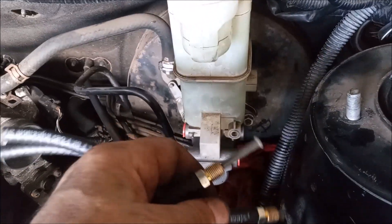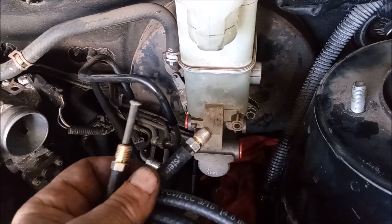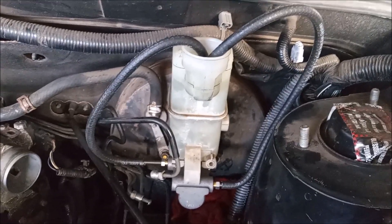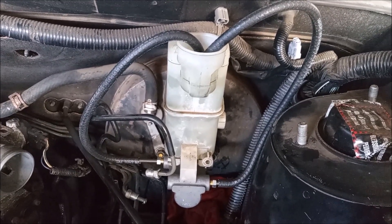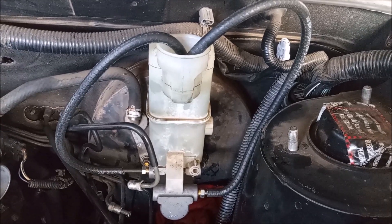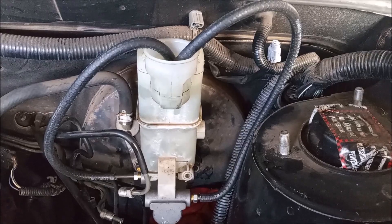I have these pieces of brake line that I connect to hoses. I'm gonna thread these into the ports of the master cylinder, run the hoses back into the reservoir, and then use the brake pedal to bleed the cylinder. I've threaded the fittings into the master cylinder, run the hoses into the reservoir, and filled the reservoir with brake fluid. Now I'm ready to start bleeding by gently pushing the pedal back and forth. The important thing is do not push the pedal all the way at first — just push it partially, a quarter of the way, and repeat that, progressively pushing it further and further.